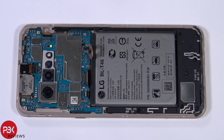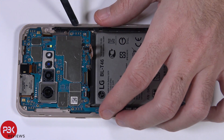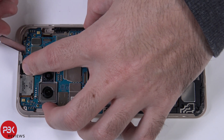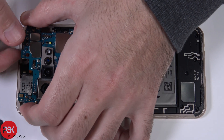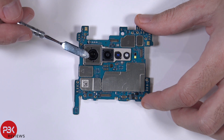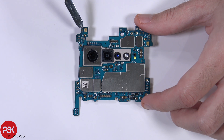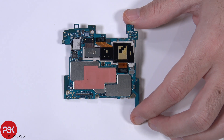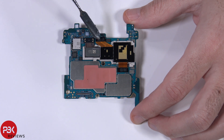At this point we're going to lift up and remove the main board. Your main camera has image stabilization. You have two mics — they're the gold pieces. On the back of the board you have your thermal pad which lays on top of your vapor chamber. Your cameras are connected over here.